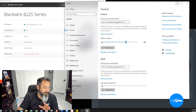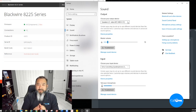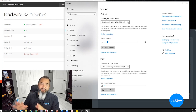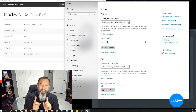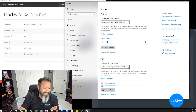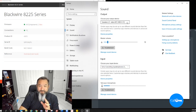Here's the key issue — you can't use them simultaneously. I have the Sound Settings window pulled up and as you can see, I can only select one audio device at a time for output and one audio device for input. So even if I have both headsets connected directly to my PC via a splitter or directly through the USB ports, I'm not going to be able to select both headsets for both output and input. That's why those splitters you see online are a waste of money if simultaneous use is your goal — don't do that.